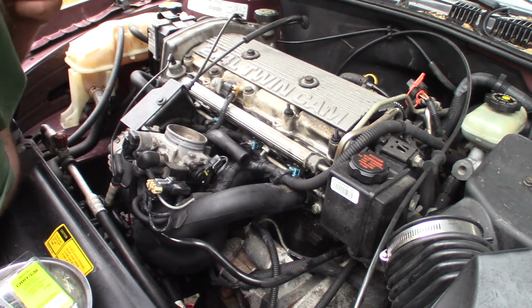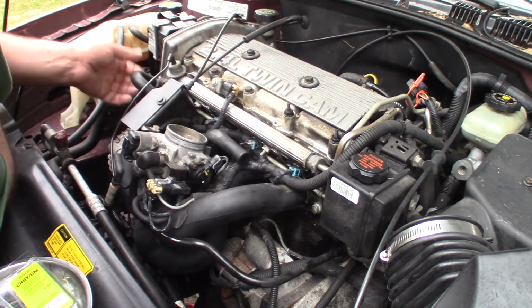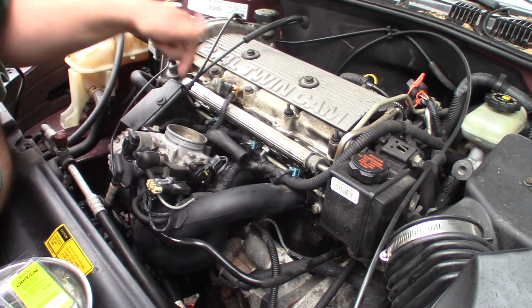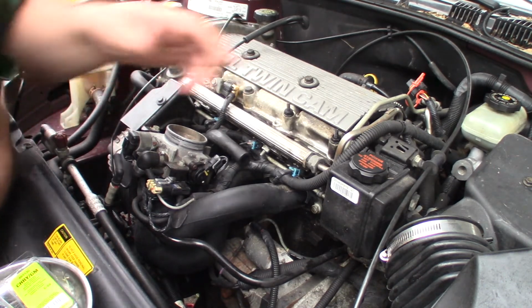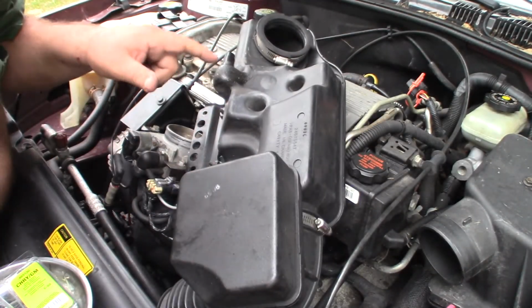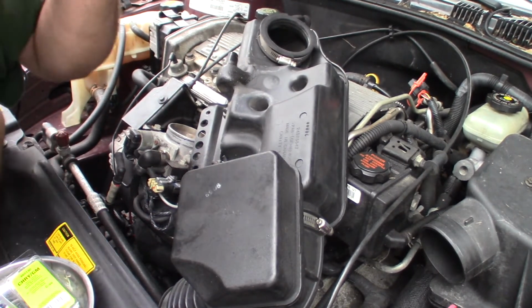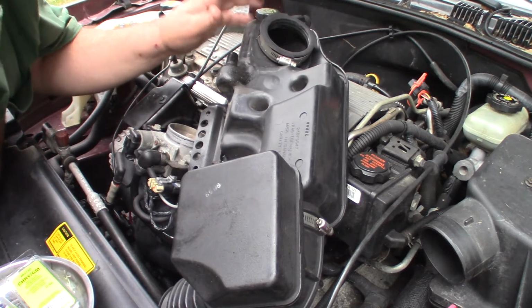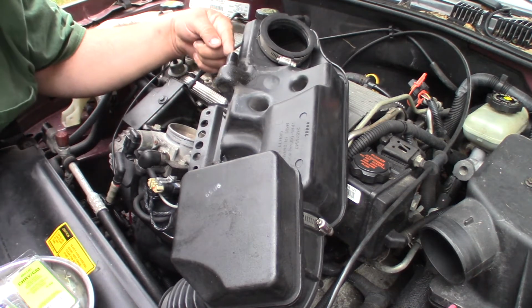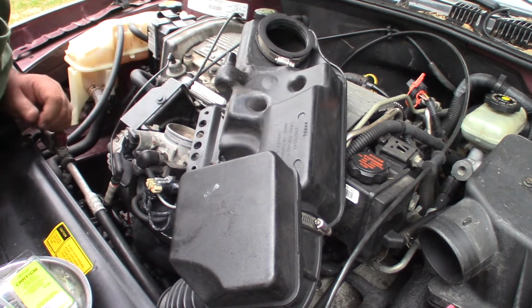But I thought maybe I had a vacuum leak, but it was actually this hose that comes over here for the crankcase ventilation, which is kind of weird. It comes off of this all the way down, back over. That was disconnected, where it would go into this air breather. And so, when I was spraying the carb clean down here, some of it was getting sucked in where that PCV hose would normally go, and so that was causing the issue.